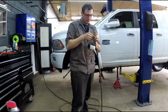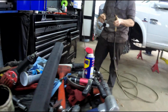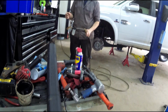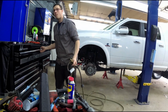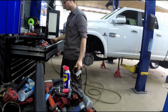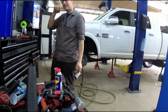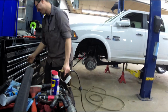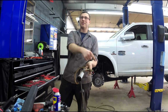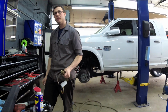This is a Snap-on flat rate leader. That should work. Oh yeah, Venturi effect. Well, I just learned that because I'm trying to figure out how to make a pump out of compressed air so I can get the water out of my pool. Get one of these, but bigger. All it is, you're blowing air across the hole. It creates a low pressure. Once it creates a siphon, you're good to go.